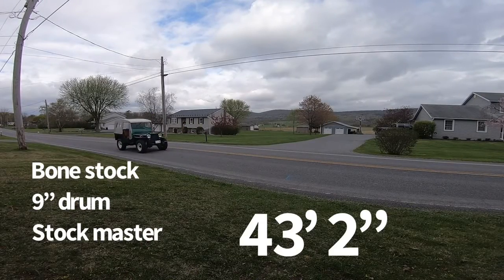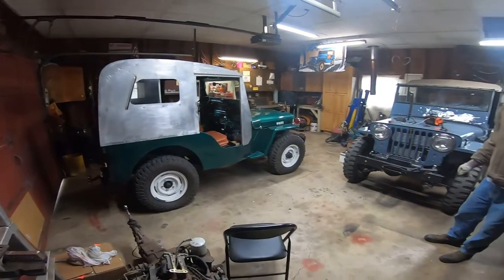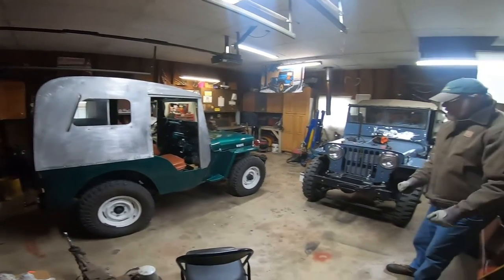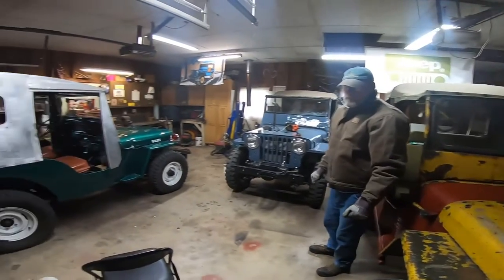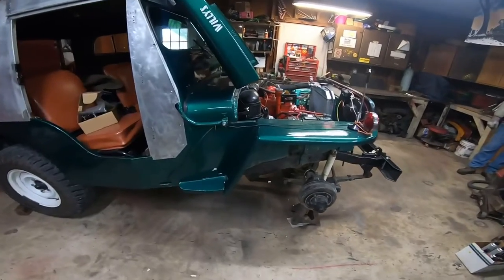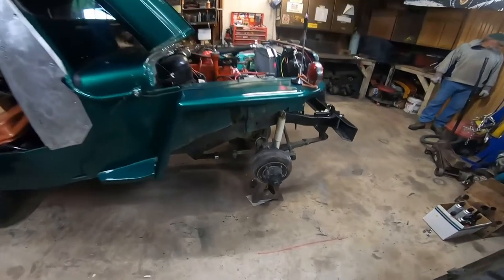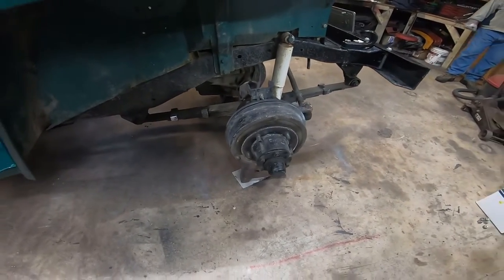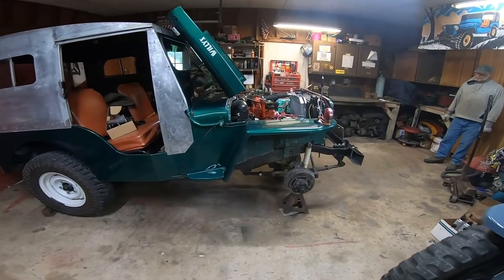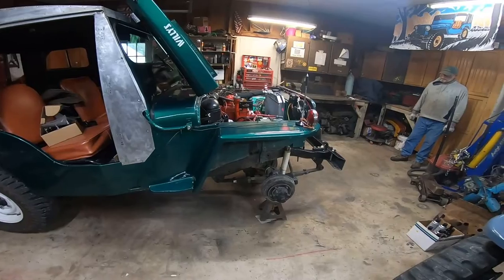That's the setup he wants, which should work fine. And then we'll put it up against one of my Jeeps that is four-wheel disc brakes. So we'll do 35 mile an hour panic stop tests and measure the distance and see how much difference it actually makes. Before we pull the drums off this Jeep, let's do a control run with stock drums — a completely stock brake system on a '47 2A. We got the Jeep in the shop. It's freezing cold — it was 95 three days ago. It's like 38 or 40 out, flurries and wind. We're going to start by taking the residual valve out of the master cylinder, and then swap the stock nine inch drums for some Dana 30 disc brakes. I'll put links in the description to another video covering that — this video is about the results.